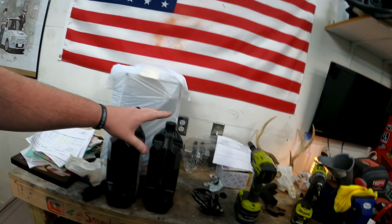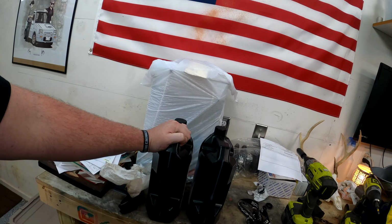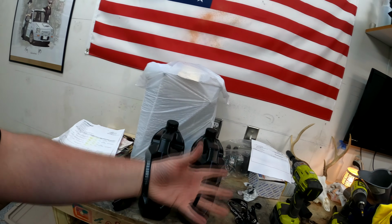So my advice, use a whole one of these, but then only about a quart out of another one. So I think all in all, you can get away with buying 4 full jugs and then flushing it 3 times, using 1 quart out of 1 jug each time for each reflush. Then for your last one, pour in your 5-ish quarts. That's about where I'm at. I had to pour in about 5.5 quarts.